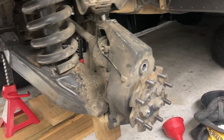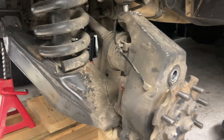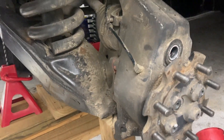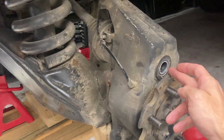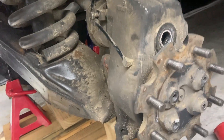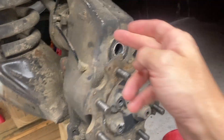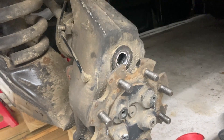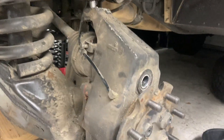There's pretty much straightforward stuff right off of YouTube - that's where I got my information, doing the same thing as some other folks. Removed the wheel, took out the plug - forget what size that was - looks like it was a 9/16 right in there to get the half shaft retainer bolt out. I was careful not to drop the washer in there; that was a good tip from some other folks.